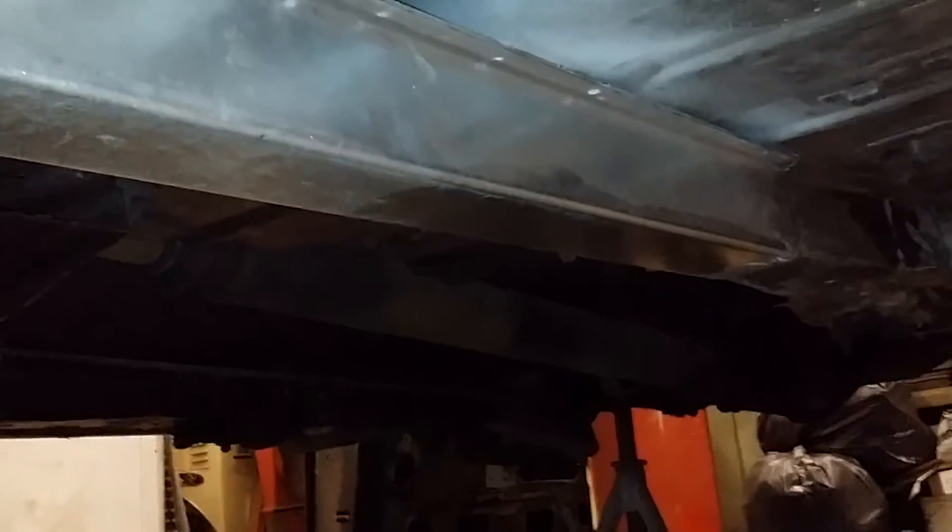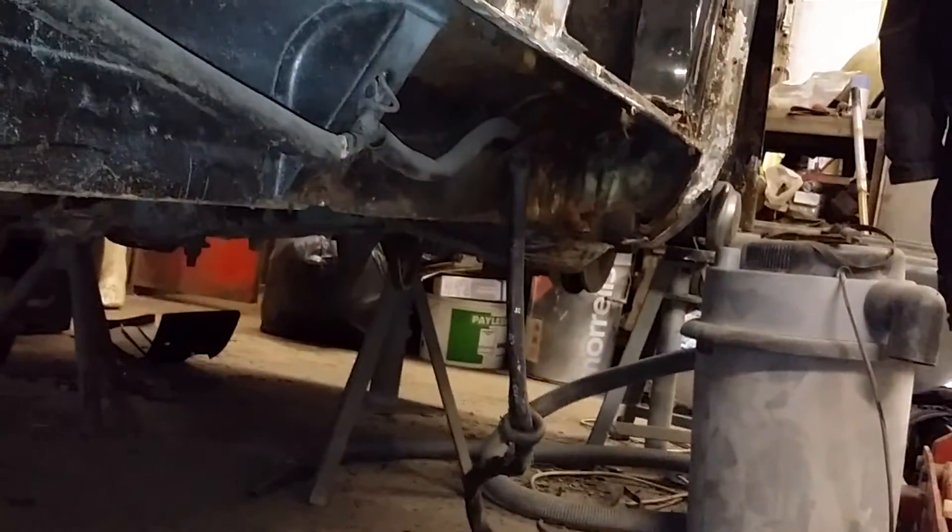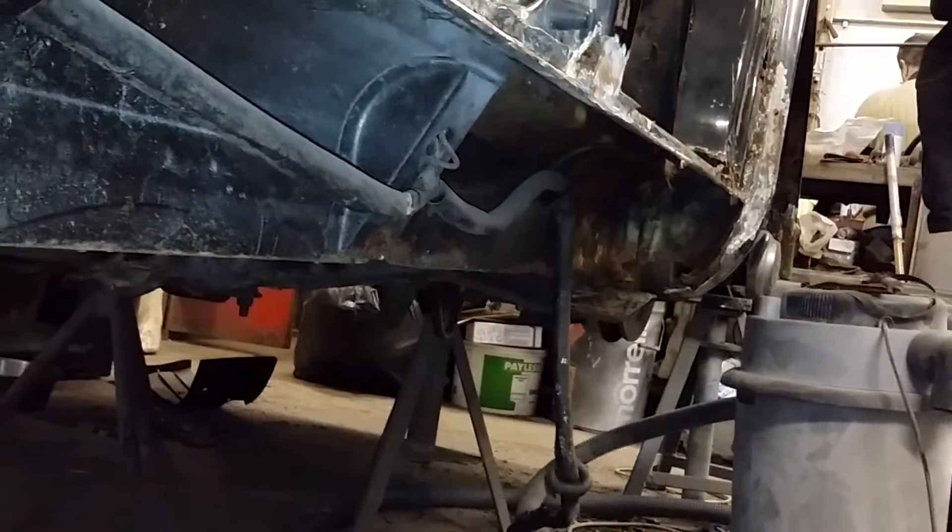If you've got handling problems like under heavy braking, it could be that your car is twisting excessively because this thing has rusted out. In addition, if the front end of your sill is rusted through, there's nothing for the sills to be hanging onto, or the rest of the body for that matter, and that too will lead to quite a fair bit of torsional weakness in the body shell.